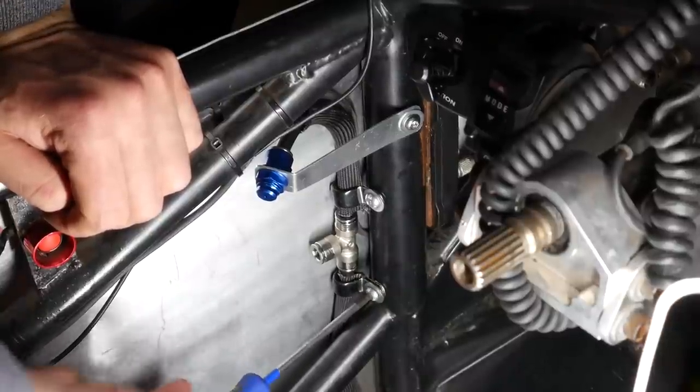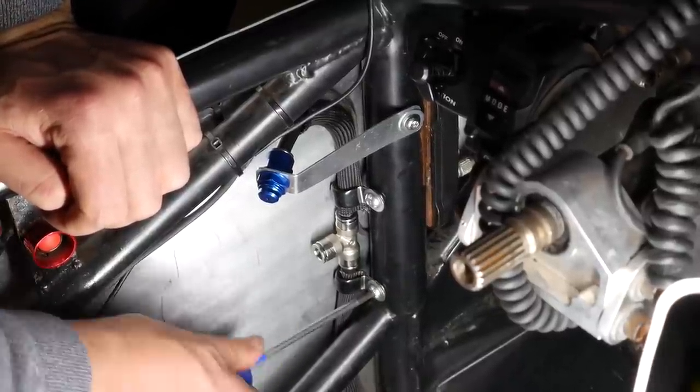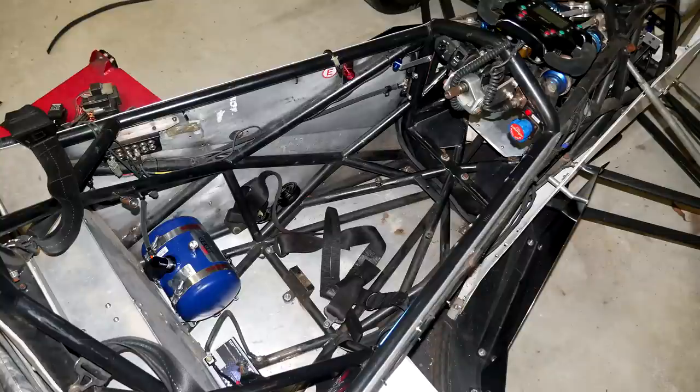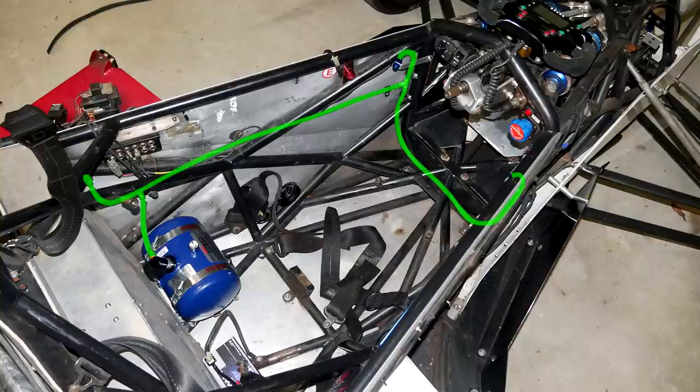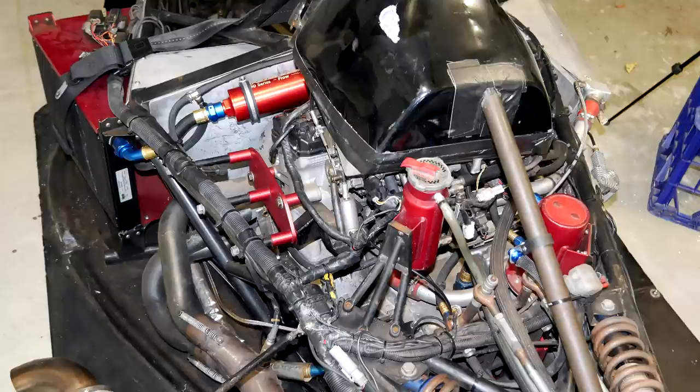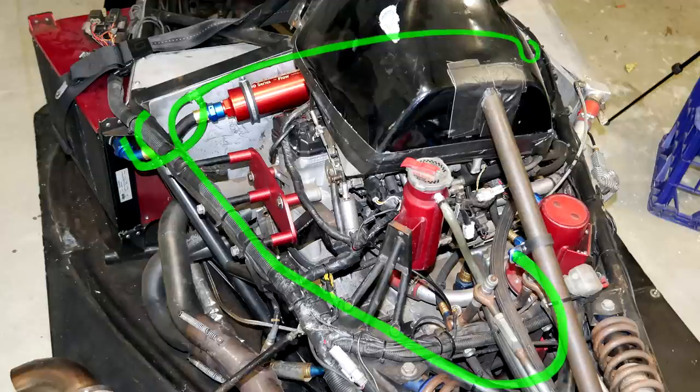If you were concerned that my machined brackets might swivel up and down, once the hose is in the back of them the whole thing becomes surprisingly rigid. It's hard to communicate the entire path of the tubing, but here goes. From the tank it goes to the side of the cockpit, with a T piece splitting towards the front where it splits once more and goes to each of the cockpit nozzles. The other end goes through a special fitting passing through the sheet metal, then in front of the oil cooler back towards the engine bay. In the engine bay it comes around the corner and splits up to the left hand nozzle. The other side travels up to the bulkhead, splits right, travelling across the width of the car to the right nozzle, and one of those earlier splits heads towards the back of the car and upwards to the third nozzle.